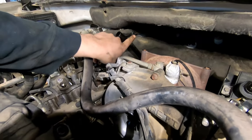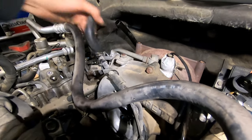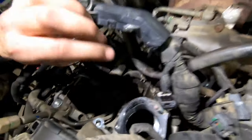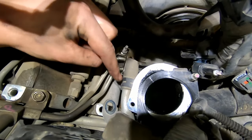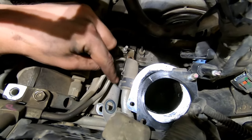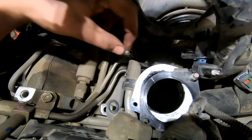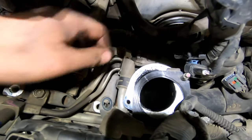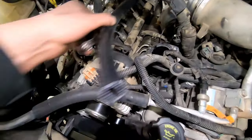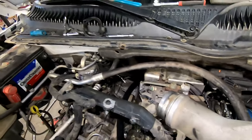Take this hose clamp off and try to twist and get this coolant line off that we cut, and same with this one right here. Sometimes I just cut it off with a zip disc because the wings are underneath and it's very hard to get off. Then just use an exacto knife and cut this hose off. Now get your new coolant line — it's going to come from right here and go back to the firewall there where you cut the old hose.